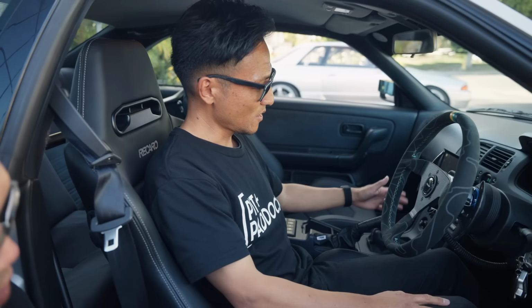But this is not a manual. It's a switch, basically acting as a micro switch. So it doesn't move side to side. It just moves forward and backwards. And it's actually a piece from a video game sim, because all it needs to actuate the air shifter is a signal. It can be just a switch. You could even have a button if you wanted.